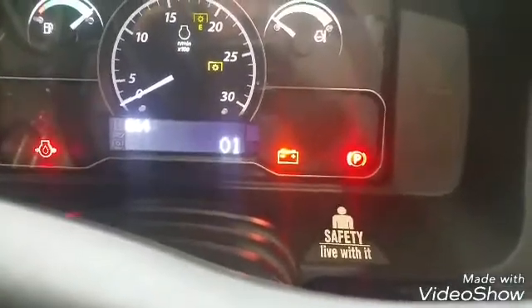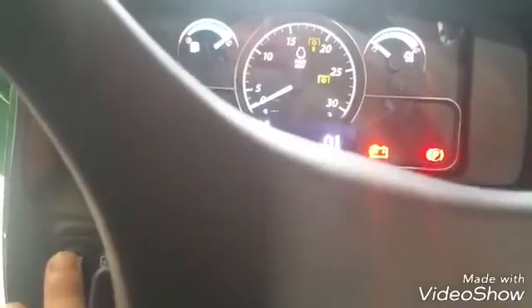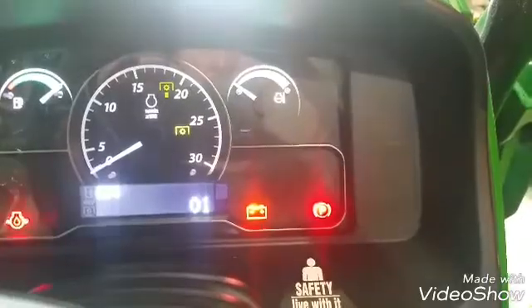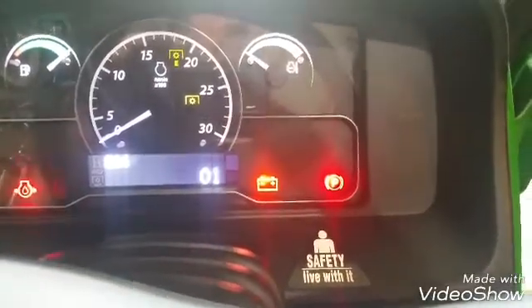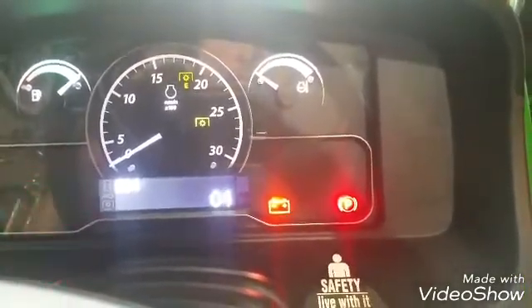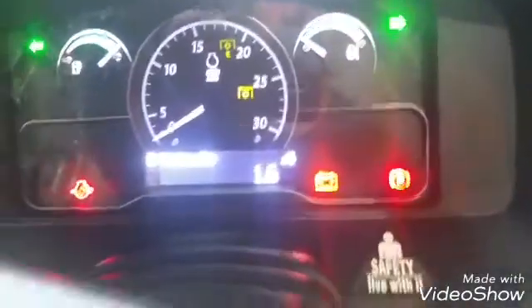Press the hazard button within two seconds. Now that digit is blinking. We want the '1' to be flashing — currently the '0' is flashing. Press the left arrow key to move between digits, then the right arrow key to change the value. Press the left arrow key to select the '1' digit, then use the right arrow key to scroll it down through the values until it reads zero. Now hold the display mode button for about three seconds to save, and it returns to the regular screen.